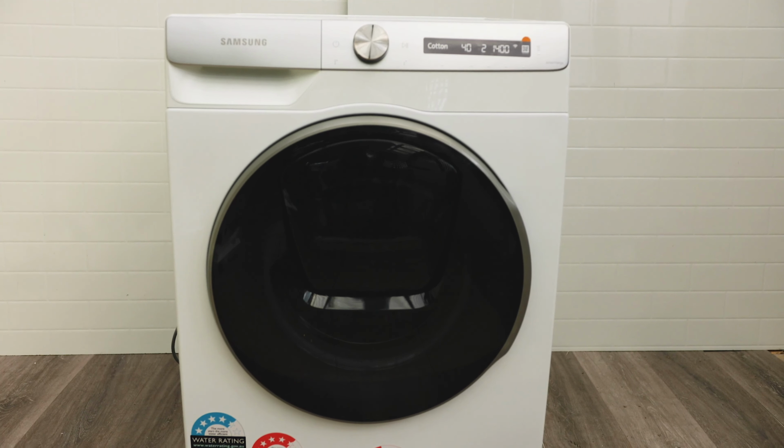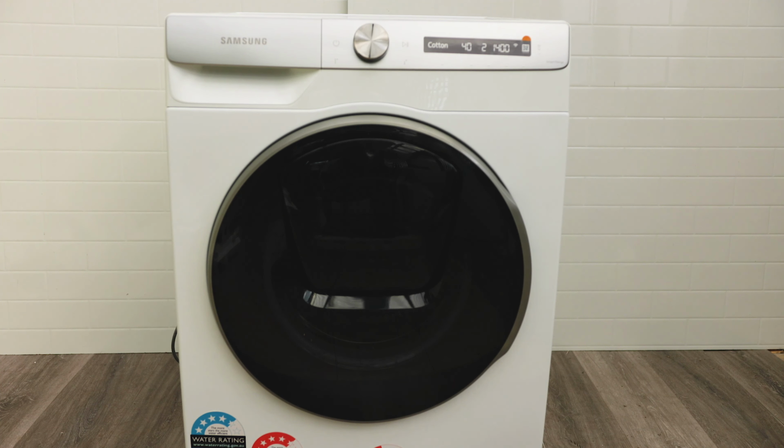So I'll just take a minute to explain condenser drying technology. This is what is working on this washer dryer combo. This is pretty useful if you live in a flat or somewhere where you can't really vent the dryer. Venting means putting a pipe that'll take the hot air outside. This will be pretty useful because it doesn't need to vent out the hot air, because that hot air is condensed down to water and is drained out. So rest assured you can do that.